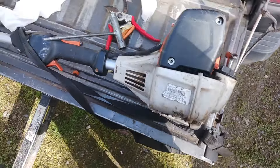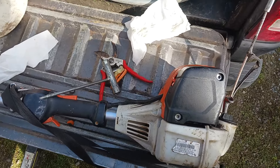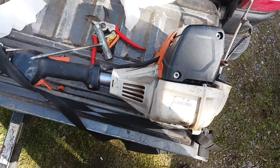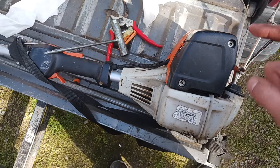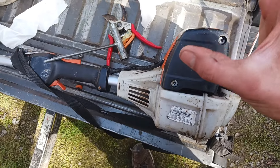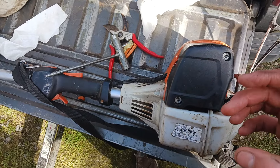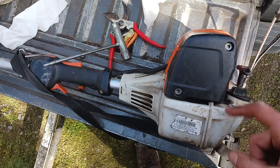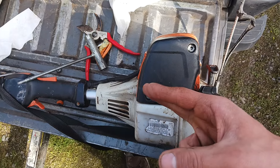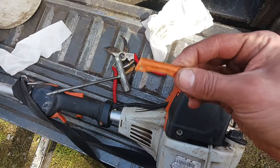Just know that is definitely a con in these FS-111s. They are very good running machines — way better than the FS-110s, the gas mileage is better — but unfortunately fuel does tend to leak in here, and those old FS-110s did not do that. The air filters on the FS-110s also did not expand; they were more of a sponge-type material instead of this half-styrofoam, half-rubber material, which is the best way I can describe it.